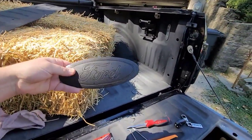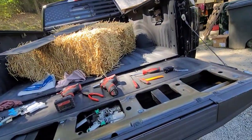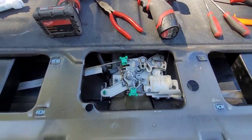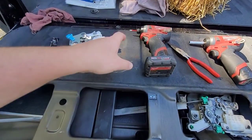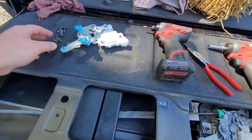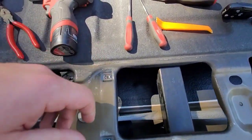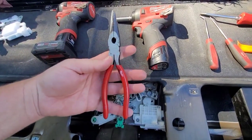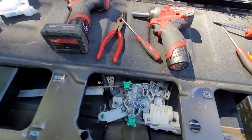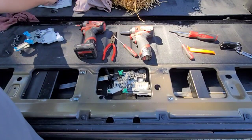You're going to take the rear plate off, which comes off pretty easy, and then there's a little switch on the inside - you just flip it over and you can unlock it manually. What you're going to need for this job is a T25 for these bits, a 10 millimeter for these two bolts, and you can probably use a needle nose and some kind of pick or really small screwdriver. Let's get into it.